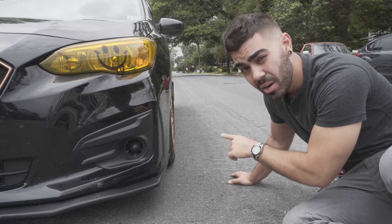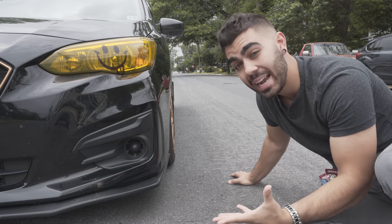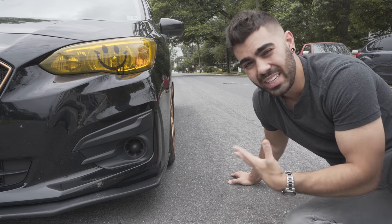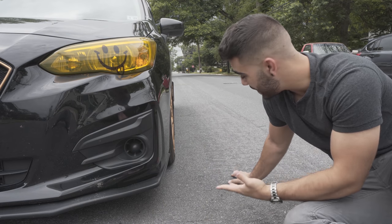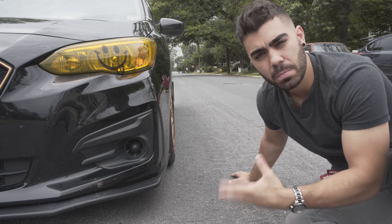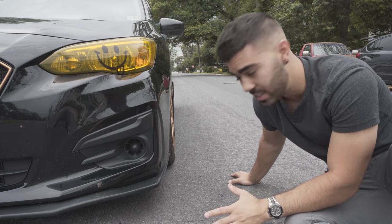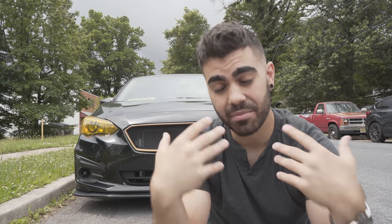Now let's look at the front. This is the camber on the front — I'm showing you from straight on because I don't want to exaggerate the angle. There's literally no angle. I don't know if camber plates just don't give you a lot of adjustment, but I'm not happy with that. It doesn't even match the rear camber. If you're going to put camber plates on it, they should at least be able to match your front camber with the rear camber when you install BC Racing coilovers. But that's not the case here. I want more camber, I want my tires to be slanted — whether it's good or bad for your car. I've already done plenty of stuff that's not good for my car. If you guys have any suggestions, please let me know.